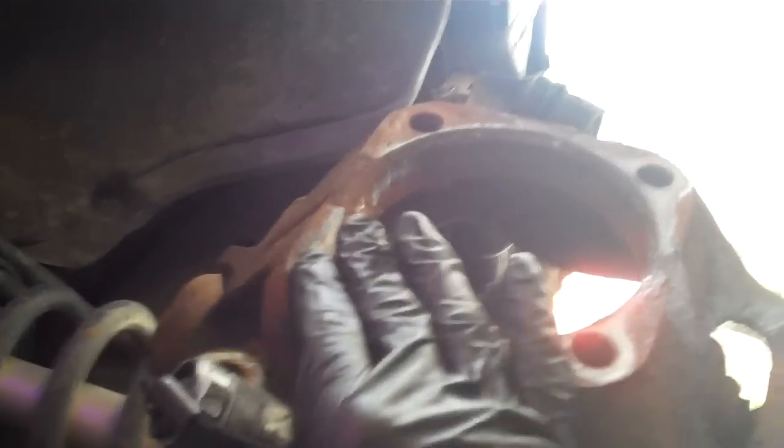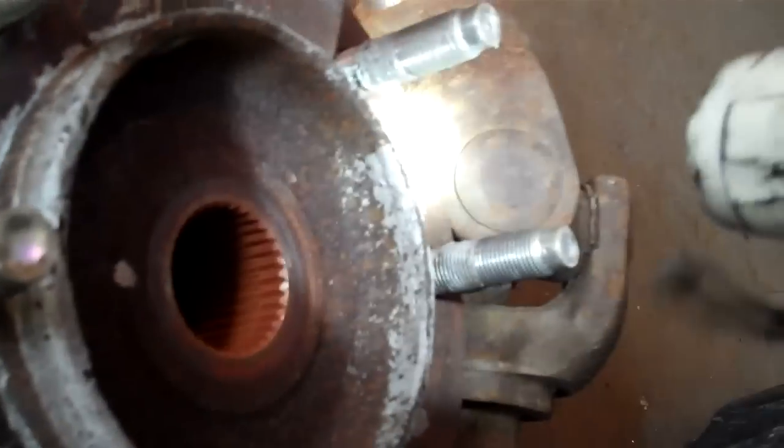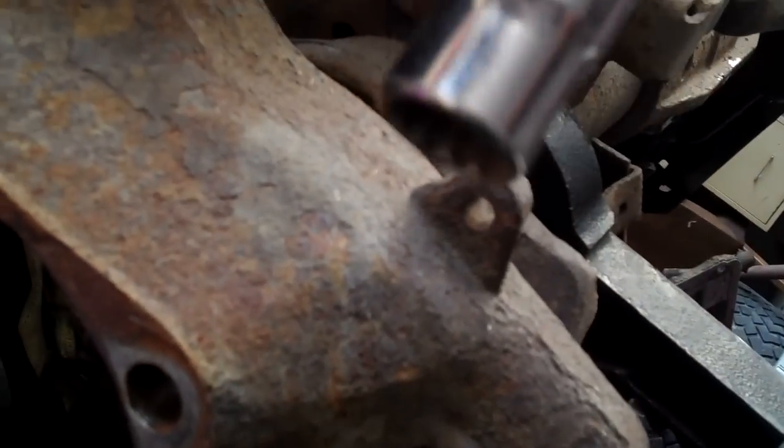If the rotor is stuck, hit it on the face on each side with a sledgehammer between the lug nuts — right here and right here on your brake rotor, just smack back and forth and it'll come off. Then you want to pull the nut out — it's a one-and-three-quarter inch. Get the cotter pin out, take it out, and then you've got four 14mm 12-point bolts that go around. Loosen them out, then tighten them back in about two or three turns. That kiss mark on the bolt is from using it with the socket on and having my assistant turn the wheel to the left — it actually works like a hydraulic press to press that wheel hub assembly out.